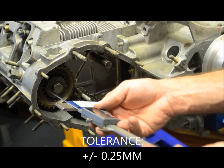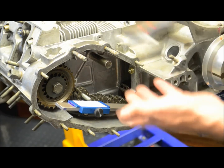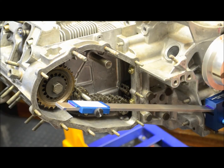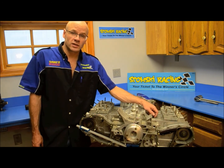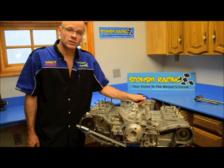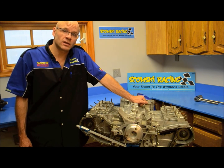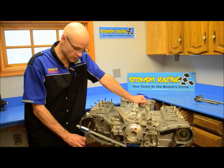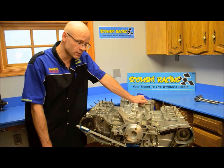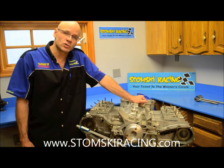Both readings are well within 0.25 of a millimeter. Again, if you need to change out the shims, go ahead and change them. Once your sprockets are aligned, the next step is putting in the Woodruff keys and completely locking down the sprockets on the end of the cams, then mounting the chains. After that, you're ready to time the cams themselves. Before you do that, make sure the cams are pointed with the Woodruff key or punch mark pointed up and the engine is set at top dead center. Torque down the bolts and you're good to go to the next step. See you soon.